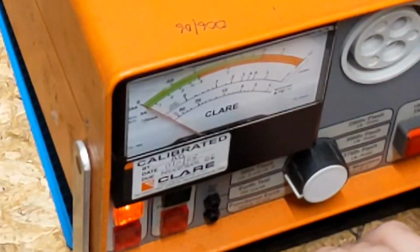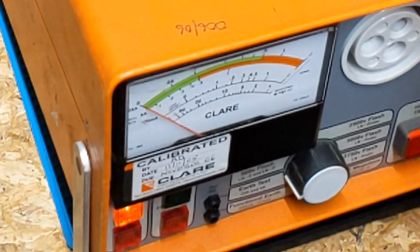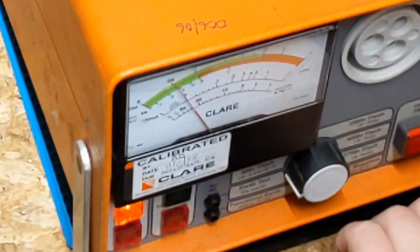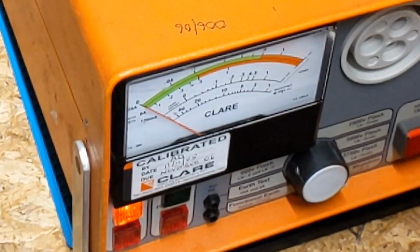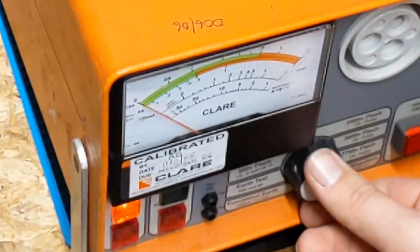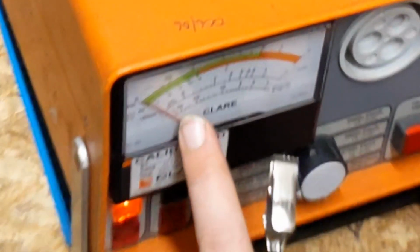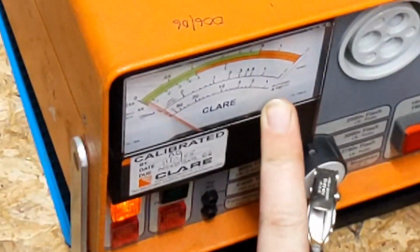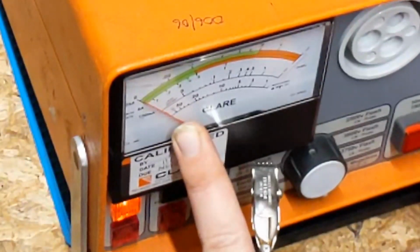It's that low, the needle barely moves. So I'll turn it up to 25 amps. I'm getting 0.05, which is very good. We'll go there for a few seconds, good. And what we'll do is, we'll do a 500 volt line neutral to earth. Again, infinite on this side. If it's moving over this side is one. As you can see, that's good. We're well over 100, which is very good.